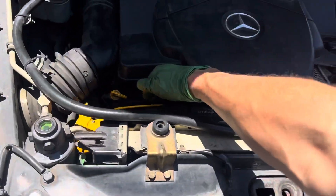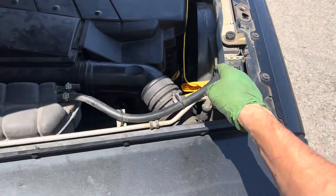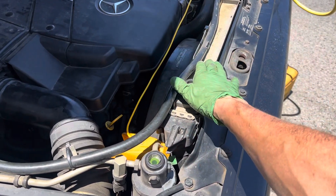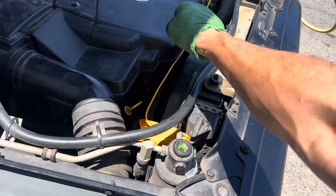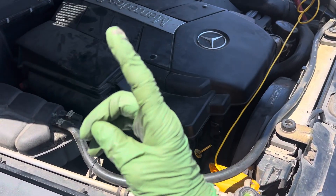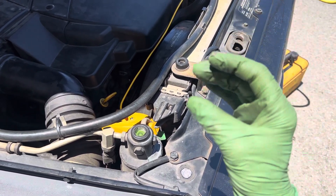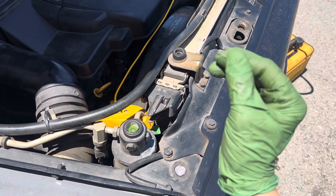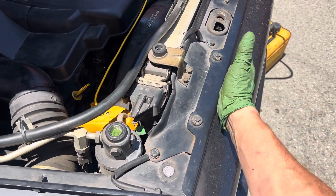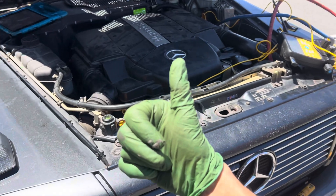Guys say, 'I feel a lot of air over my hands, the fan clutch must be working because engine temperature isn't going up.' But the amount of air needed for the oversized radiators they put on engines — because they don't want engines blowing up under warranty — means the cooling systems are oversized. So a lower airflow by a couple hundred CFM won't affect the temperature gauge at all, but it will greatly affect the condenser, because most manufacturers make condensers as small, light, and cheap as possible — they just work. You just need to add another straw to break the camel's back, and that's why the electric fan is cycling so much while the mechanical one isn't doing its job.